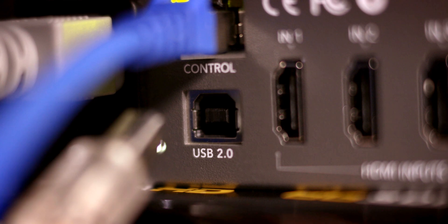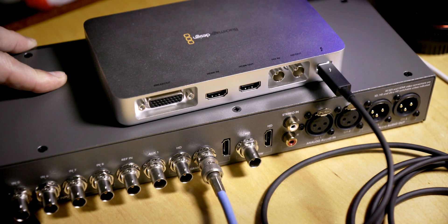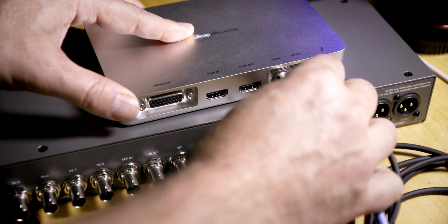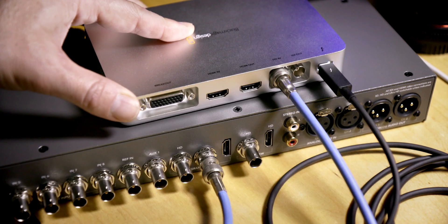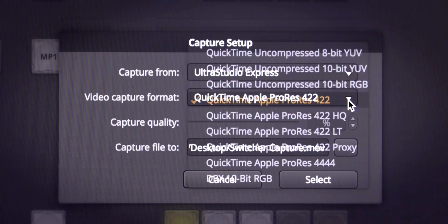Let's talk about the USB port on this unit because there's a little bit of confusion. The standard HD older-model ATEMs will actually output either H.264 compressed video or in one or two cases uncompressed video out of that port. The 4K models don't do that. If you want to record or stream, you're going to need a different interface — for example, I have an UltraStudio Express. A cool option in the ATEM software is that you can actually capture from the UltraStudio within the interface: go to the top right, select capture, set your input up, and capture away.